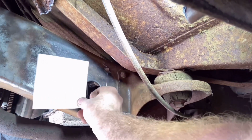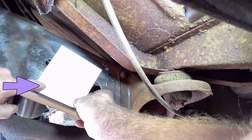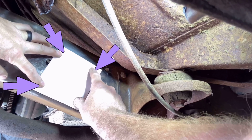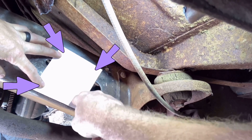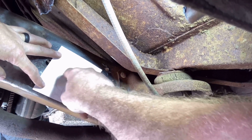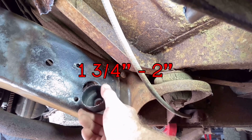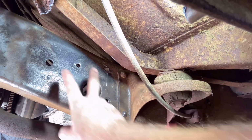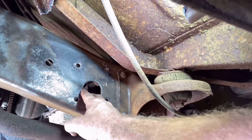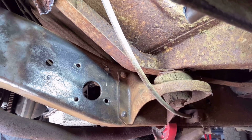Move this forward to that hole and pivot that where it lines up and drill 3 new holes there using this existing hole. And then I'll center punch that and cut that hole out using a 2-inch hole saw. So we'll go ahead and knock this one out the rest of the way, and I haven't even started the other side, so we'll get that one done too.